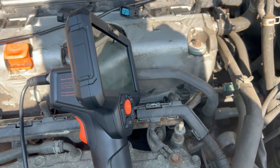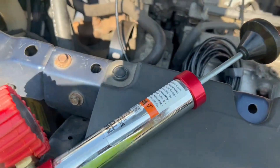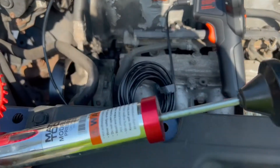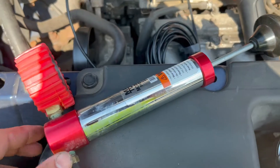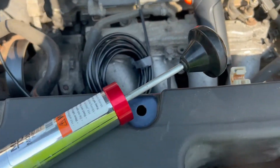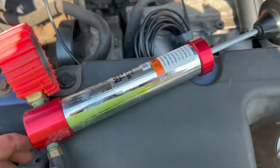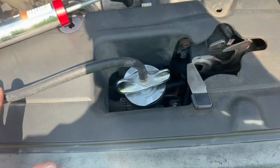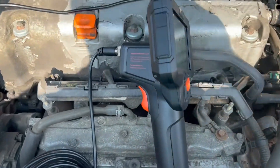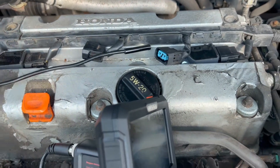You need a camera like that — I'll put a link in the description. You also need a radiator pressure tester like this. It doesn't have to be Matco; there are a ton of other brands and I'm sure you could rent them from your local hardware store. I got a good one just to make sure the tool itself isn't leaking during pressure testing. You'll also want an adapter kit. You pressurize your coolant system, take out your spark plugs, and put the camera down in there.